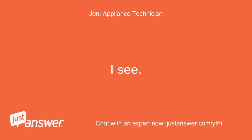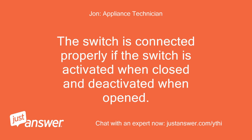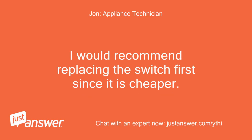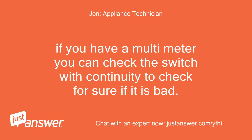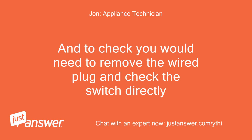I see. Thank you for the pictures. The switch is connected properly if the switch is activated when closed and deactivated when opened. But if the computer still recognizes the lid being open when closed, you either have a bad switch or control board. I would recommend replacing the switch first since it is cheaper. And if that doesn't work, replace the computer. If you have a multimeter, you can check the switch with continuity to check for sure if it is bad. If it is bad, it will not have continuity. And to check, you would need to remove the wired plug and check the switch directly.